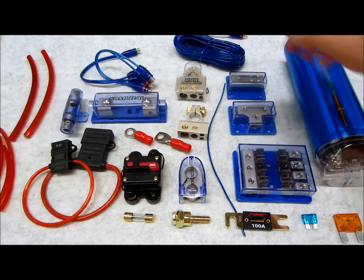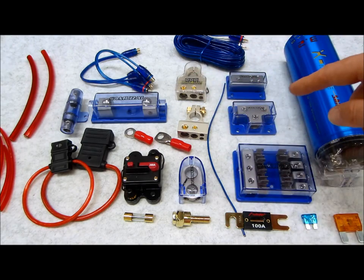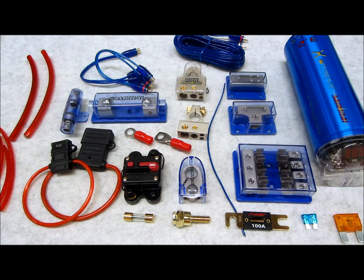Some amps will have RCA pass-through circuits, which basically means you'll have two lines of audio in, and you'll have another pair of jacks, which are females, to daisy chain out to another amplifier. It does happen. There's a lot of amps out there that have it. If you want, you could of course utilize that feature. If not, some of the other things that I talked about might work out better for you as well. So the least desirable method is the Y splitters. The best is the signal processor. So with that said, you have your RCAs basically covered.